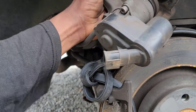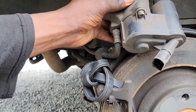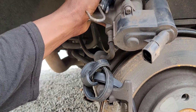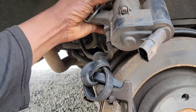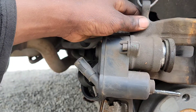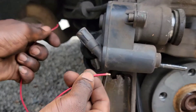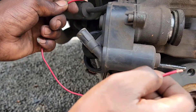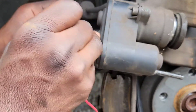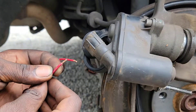There are two pins right here — locate them. Hook up the caliper and get it set up. What you're going to do is test the pins to see which direction brings the piston in and which brings it out, before you attempt to compress the piston — you don't want it going out. Touch the two pins; if it goes out, switch the wires around just like this.